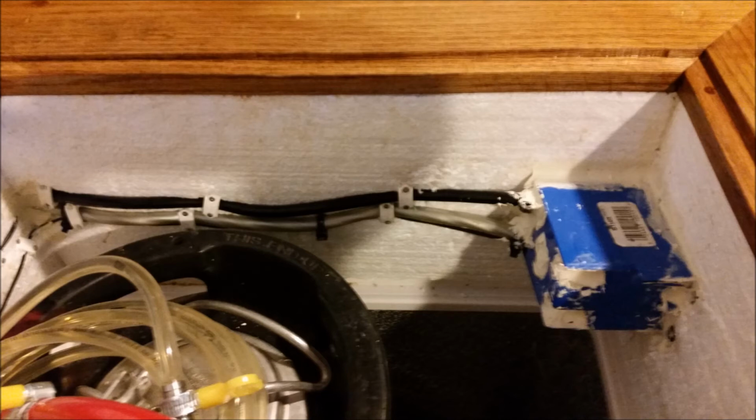You can see the power cords coming out, the inputs the black, the outputs the gray, and you'll notice that the output of the gray goes to the back, and it's a power strip, and that's where the Keezer itself plugs in and where the power supply for the fan plugs in. So whenever the controller turns the Keezer on, it's also going to turn the fan on.